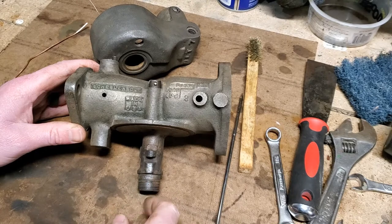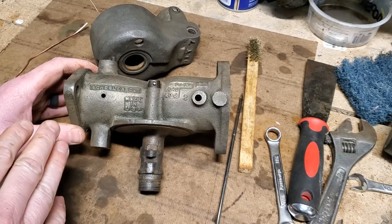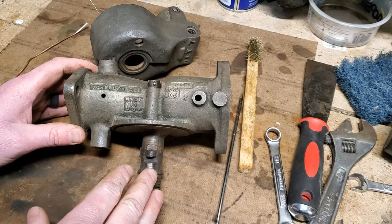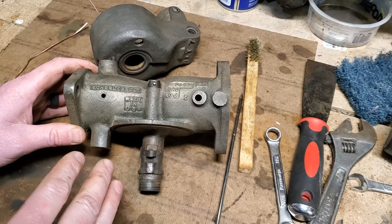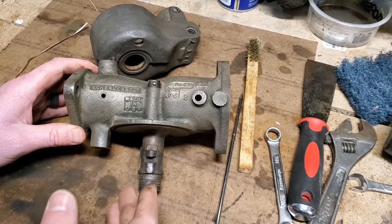This right here is just a portion of what I scraped out — I tried to save it and this is about a third of it. There's just a lot of this really fine oxidized metal that you really got to get out of there. Now that we have the carburetor clean and free from all the grease, grime, and rust — especially down in this stem and the bowl — we can go through and make sure all of the passageways that the fuel needs to go through are clear. Disclaimer: I'm not an expert on these carburetors, but I have been through quite a few of them.